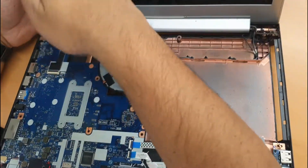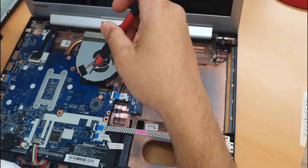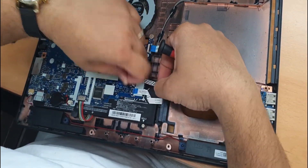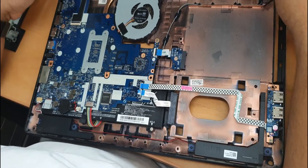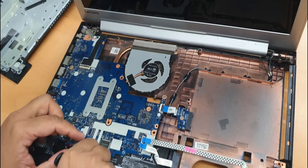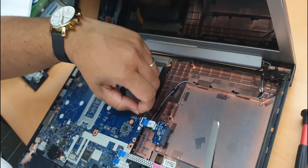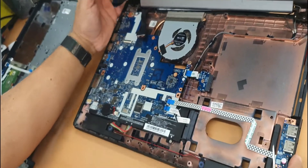Can you see the base? Both of them are broken. The base is broken anyway. The second thing is to pull out the battery — but first, disconnect all the flex cables, whatever you can see. Make sure you remember, if this is your first time. First thing first: disconnect this port — first the battery connector. Then you are safe. You can do them one by one, or you can do all together, it depends on how much experience you have.